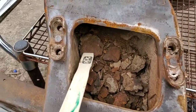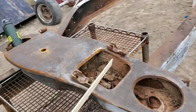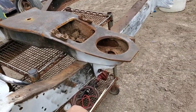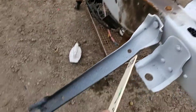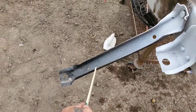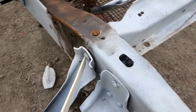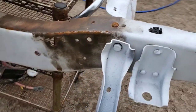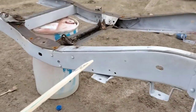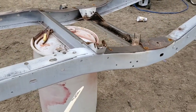Look at all this — it's just dirt powered in here. I did take off the suspension, the lower control arm shafts with the whole control arms, the upper control arms from the bottom, and I left the whole frame just as is. This bracket is part of the front bumper, but this has made it through the entire disassembly of this chassis. This bolt is through this side but somehow I can't fit a socket in there to take it off, so I need to grind it off. We'll come back — I want to throw some better 2K high fill primer and go with the automotive base coat clear on this one.